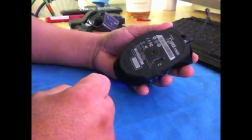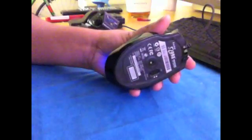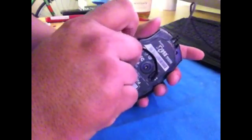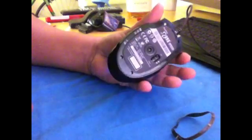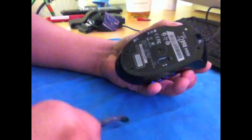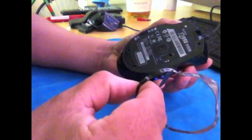First, you're going to flip it over. You'll see the Teflon tab — you're going to want to take this Teflon piece off. It's like a plastic with sticky glue on the back; don't worry, it'll re-stick. There are four screws underneath. I usually use my fingernail, dig in on the side, lift it up, and then just pull the whole thing off. Try not to stretch it too much; it'll come off pretty easy. There it is. Now you'll see four screws you've got to unscrew. This is your Teflon — we're going to reuse it, so save it and put it to the side.